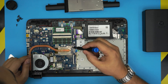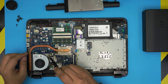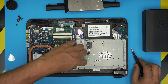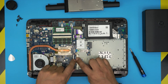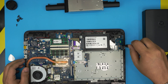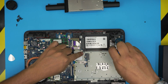Inside, the fan system has been modified by a previous owner — the fan in there isn't the original. We need to remove the whole motherboard. This flex cable here is for the keyboard. Start by removing everything: speakers and all components. Remove the screw for the USB port right here.